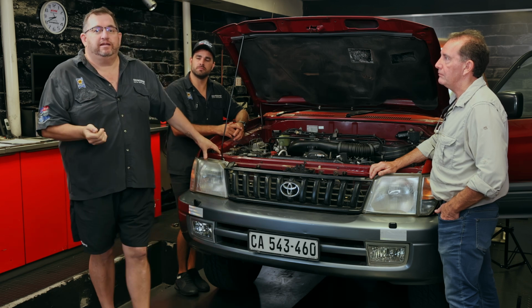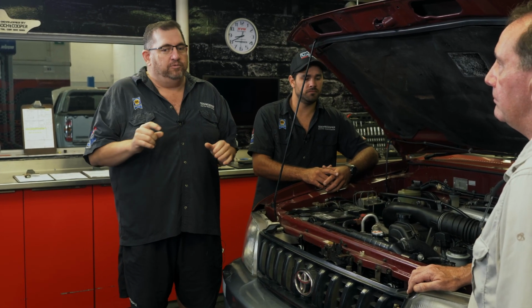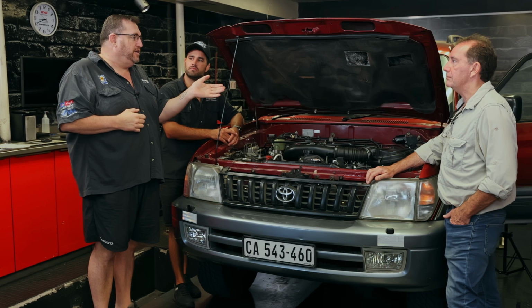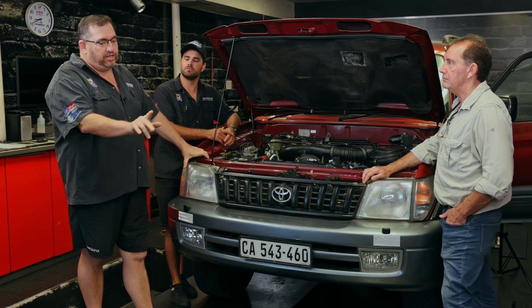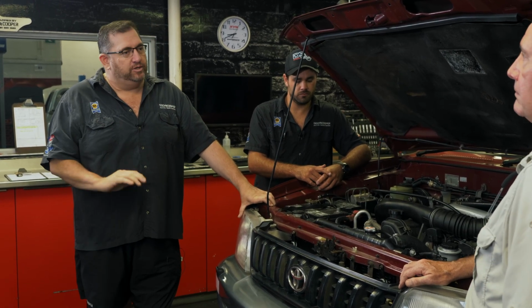From there, what we like to tell the customers is to head out on the highway and alter your speed. So apply the normal road speed, 60, 80, 120. That will build a good memory. Basically to do the same thing that we were doing over here. And from experience, what we've seen is 20 times in one direction, 20 times in another direction is normally basically done. So you'll accelerate from basically 80 on light throttle up to say about 110, 120 and tap off, and then on a deceleration. That's how we've been doing it for years, and it works absolutely like a bomb.